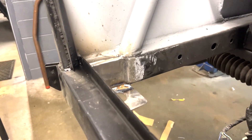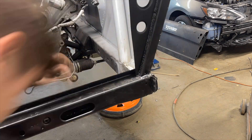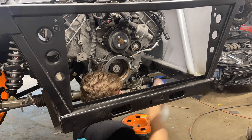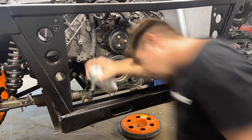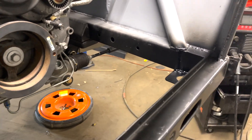I got both bottom steel sides welded in and the welder is doing a lot better — I guess when I switched the settings from aluminum to steel I picked better settings than before. Now let's get this area painted. We sprayed some etching primer and then some black rattle can paint. I know some people don't like rattle can, but honestly most of this is going to get re-sanded down and once we're ready to paint the engine bay we'll throw some base coat clear coat on everything.